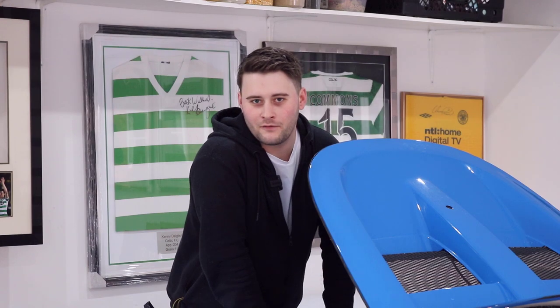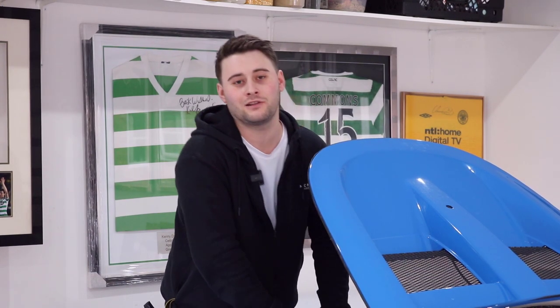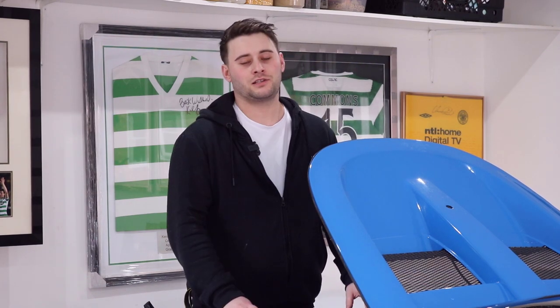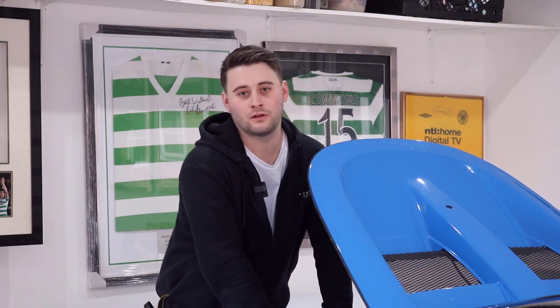I am the proud owner of this Lotus Elise S2. Now, when you go on Wikipedia there is a lot of negativity, but don't always base the car off that — don't let it discourage you from buying it. This is a K-series Rover engine and it is prone to head gasket failure. It's usually between 30 and 50k miles when the head gasket will tend to go in these cars.